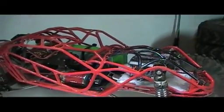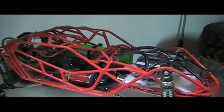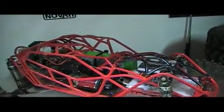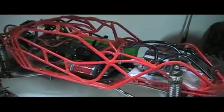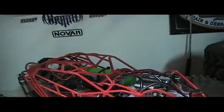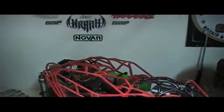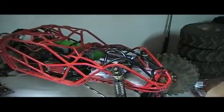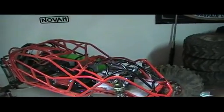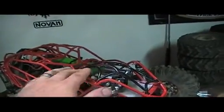After changing out to the 2-speed RC 4-wheel drive transmission, the motor temps have gone way down, well within the acceptable range. So that one's running great on a 5,000 milliamp 2-cell 20C battery, and of course the MSR11 shocks and pretty much everything else on it minus the chassis is all done up in VP.